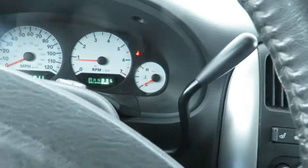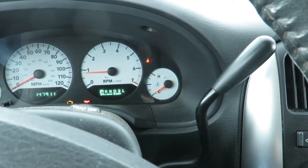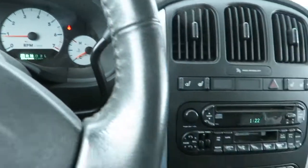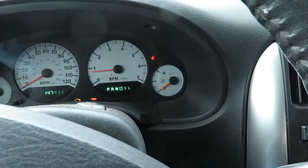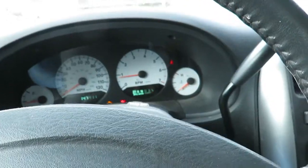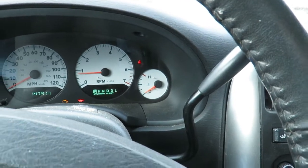After I picked this vehicle up a few months ago, I noticed it wasn't getting warm that quick. I believe the thermostat might be stuck open — I'm not getting any heat yet. I'm getting some heat but the gauge isn't moving; it could be the gauge. I've got heat running but that gauge is not moving — I'm gonna have to look into that.